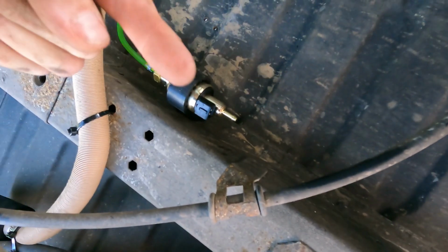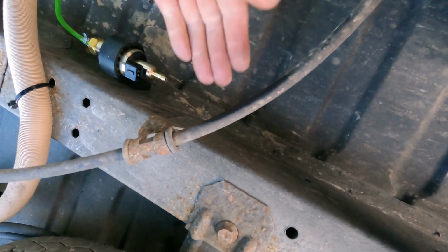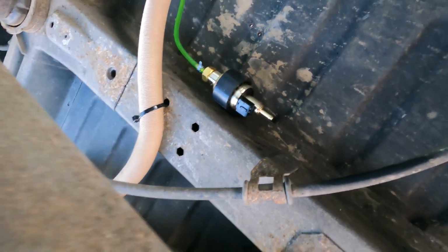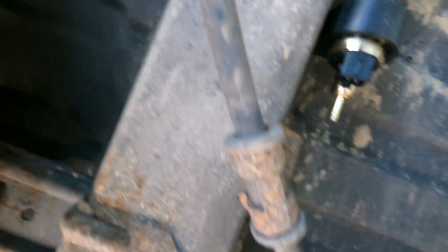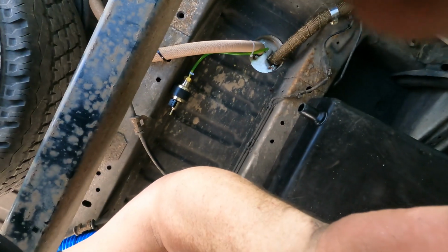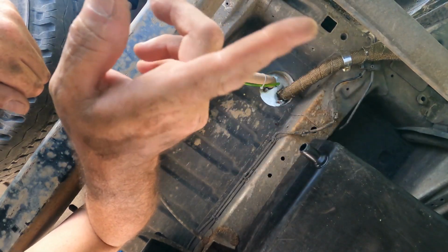So this is the heater. The diesel comes from the tank this way into the, there'll be a filter here in a minute, into the filter, into the pump, and into the diesel heater. So now we're going to do the pump. Can you see if it's there? No, too far out, isn't it, really? Right, if that's the diesel heater there, you can see that there.